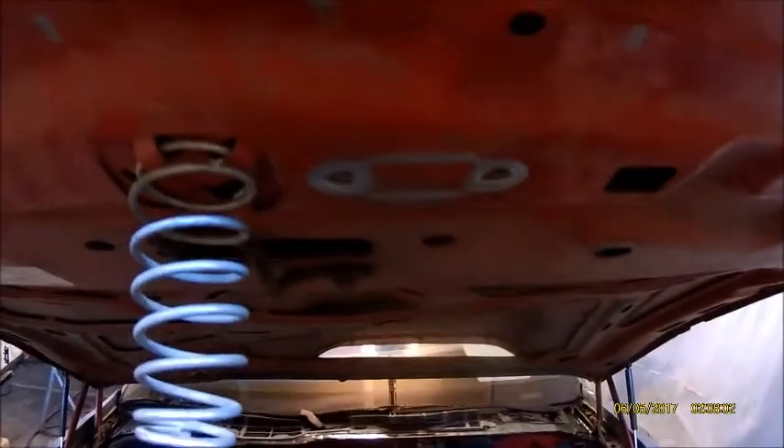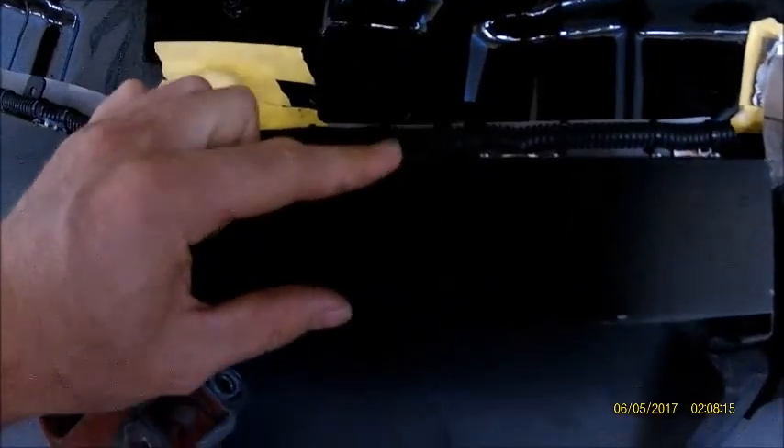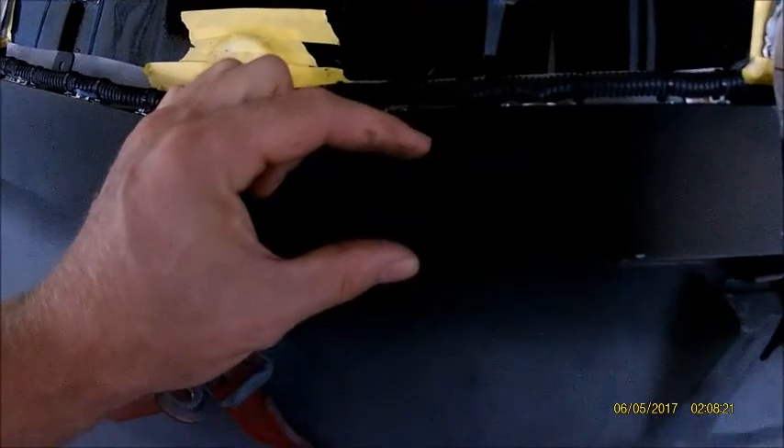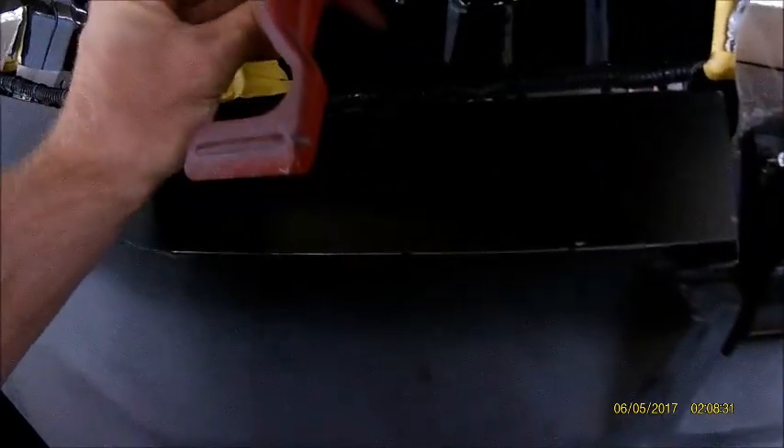One option is to remove it and just toss it. Make sure you always have the hood closed all the way. Or if you want to keep it, you're going to have to bend this back. Depending on how long your scanner is — some are shorter, like an LED one from Sidra which is real short — everybody makes them a little different. So depending how long it is and where it's sitting on your bumper will tell you where you need to bend this back.